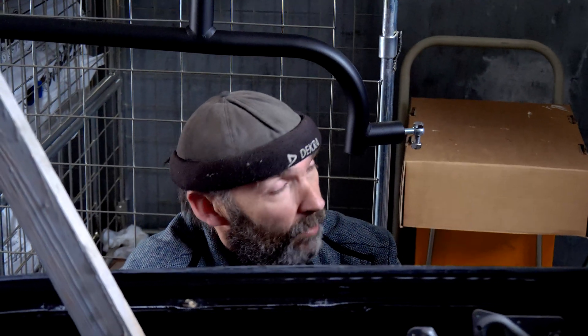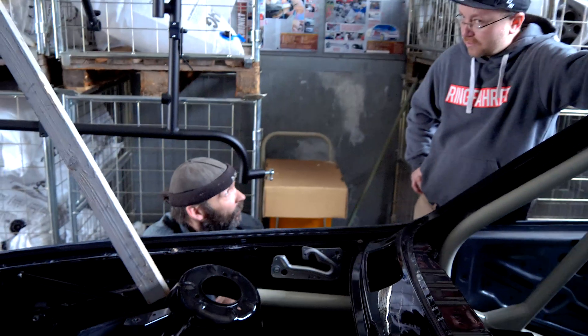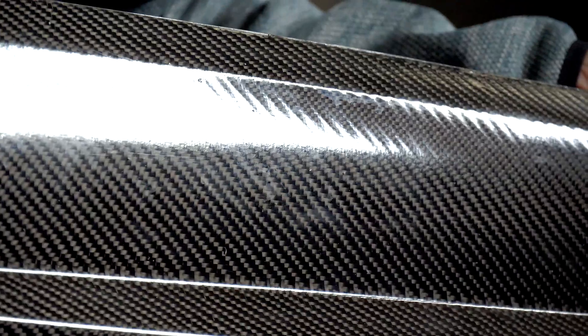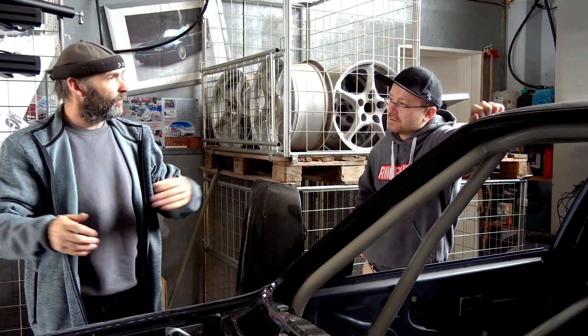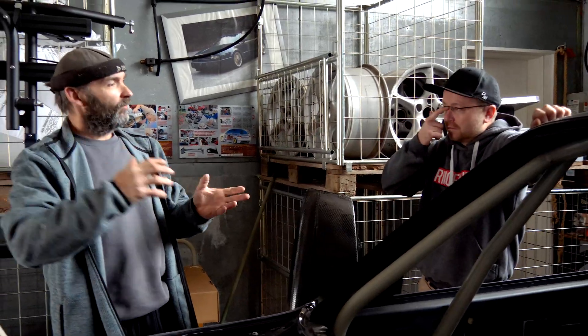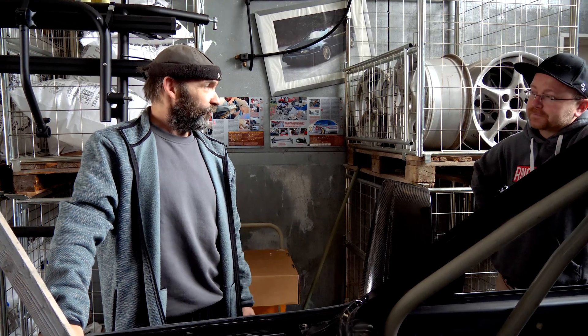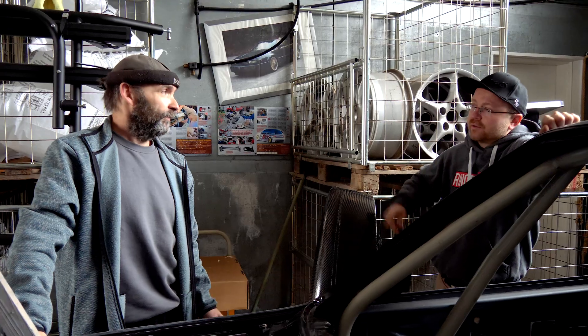Could it happen in two years? It can happen. René says if the car is placed directly in full sun, it will burn through — the carbon structure comes through, like what happened on the part we saw — wavy and burned through from the carbon. But clearcoat helps. René has not yet had parts with clearcoat that burned through, though it can happen. This was new information — the first time dealing with visible carbon on this scale.